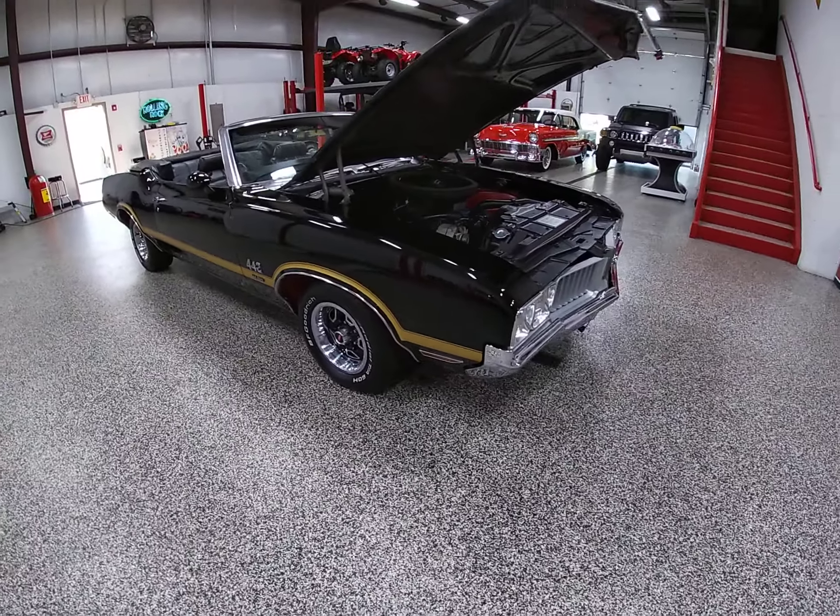And under the hood — the holy grail. It's a 455 W30 with F-heads and the correct carburetor, even though a few people say it's not — I guarantee you it is. This has standard front disc brakes; the W30 was not available with power brakes, although you could get power steering, which makes driving these bigger cars a little better. About three months ago the battery was replaced. This is not a fake tar top — this is the actual Delco, what we used to call tar tops back in the day. We've got our red fender liners, correct air cleaners. A few items may not be original, like the alternator, but all in all you've got the aluminum intake and it is all there. We also have a breakdown of some of the numbers and pictures of the cowl tag.